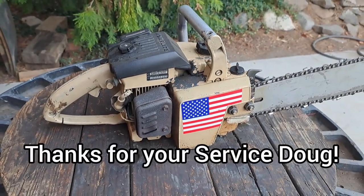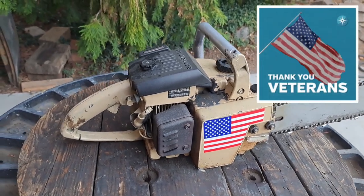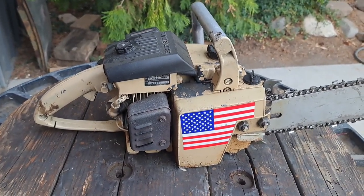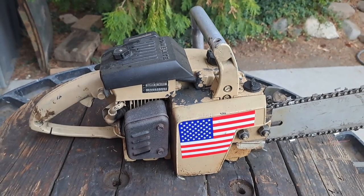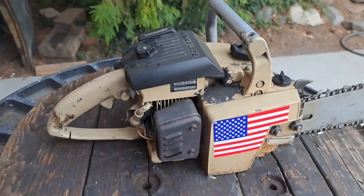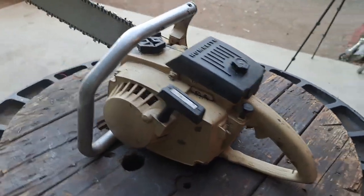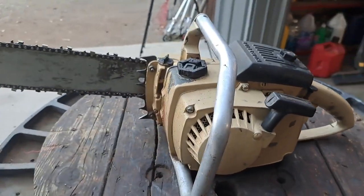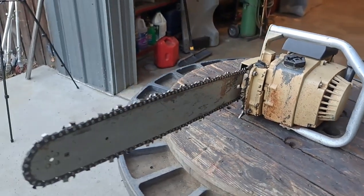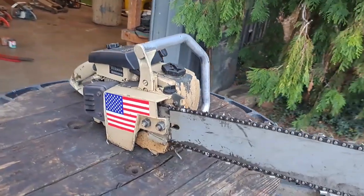I mean, none of these saws, except for the one, have I actually had to dig into the motor on, really. It's mostly just external stuff, you know, points, ignition. You can put a chip in them if you want. Carb kit, and just clean them really well, and they'll run forever. That's mainly why a lot of them get shelved, is because the carb diaphragms get too stiff and it won't run, and then, yeah, there it sits. And so a lot of them don't really have a lot of hours on them.